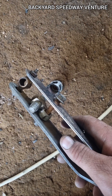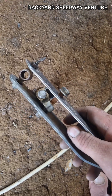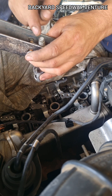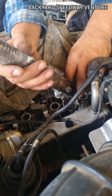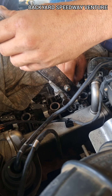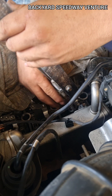Now you put the magnet pen down in that gap there to pull the valve stem up, and then you flick your collets in. So this bit is on this side, but you can swap it around to that side, which is what I'll do. Put the bolt in this hole. I'm hoping that I've made this sort of universal enough to be able to use on other projects.